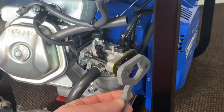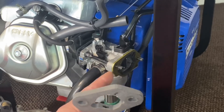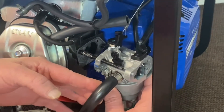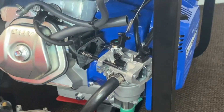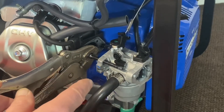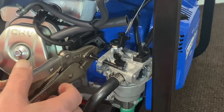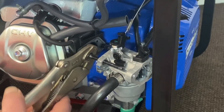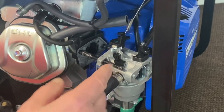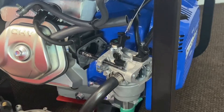In order to get our slim adapter to fit on here, we're going to be extending the air cleaner out. Our studs are not long enough, so what we have to do is remove the metal plate and pull the gasoline carburetor forward. Get some vice grips on here and back them out about three to four full turns. That'll give you enough space to install the adapter and get everything back on. They're not locked in — you can pull them out easily and there's still enough meat back in here for stability so you don't lose any strength on the carburetor.